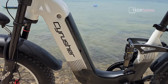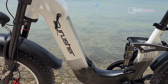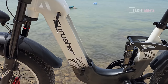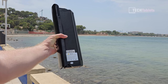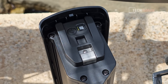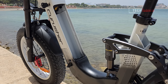The 14 amp-hour battery is locked into place, takes approximately seven hours to fully charge, and is easy to remove — insert the key, turn it, it pops out slightly, then you pull it out. You can also charge it in the bike via a port in the frame. It's 672 watt-hours and uses LG or Samsung cells, which is good. The battery has a status indicator LED showing red, green, and blue for different charge levels.